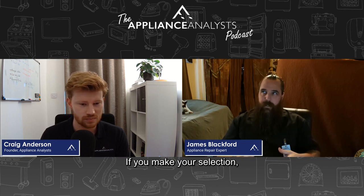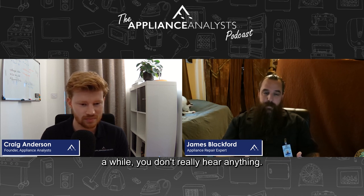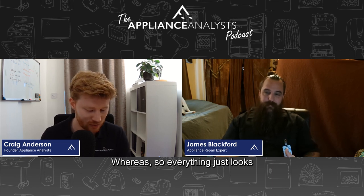If you make your selection, you hit the button, you shut the door, nothing's blinking, and then it's just kind of sitting there for a while. Typically, what happens is it doesn't fill. And so if it's sitting there for a while, you don't really hear anything, then you hear the motor turning, and nothing's getting clean. You want to open it up and make sure it's actually filling with water, because that's another thing that could happen. Yeah, so everything just looks like it's going, and then the water's just not getting in there? Right. Yeah, you'll hear the motor moving and everything, and just nothing's getting clean.